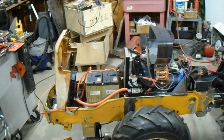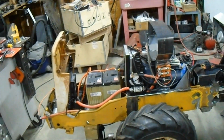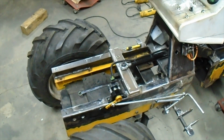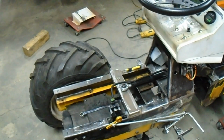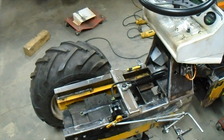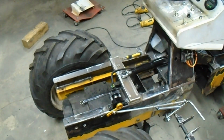Anyway, I had the wrong wires coming out of the controller to go to it. So I had the wires for the rheostat, but I have a Hall effect sensor. And that makes a big difference because there's no wiper per se in a Hall effect sensor. In a rheostat, basically you have a coil of wire that goes around in a circle, and then you put voltage in one end of that coil, and then you have a little wiper that moves along that coil of wire, and as it gets further away from the source of the voltage, the voltage drop increases. So as you push the throttle further, the voltage goes down. They also have them the other way around too. It goes the other way too.